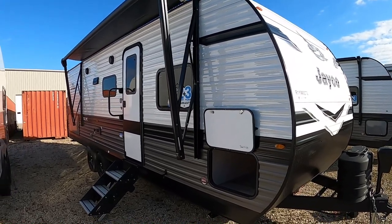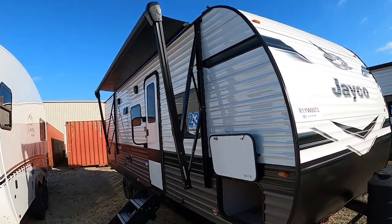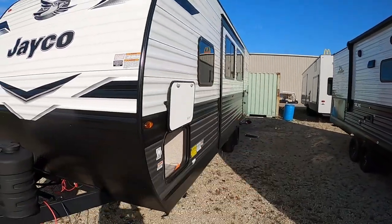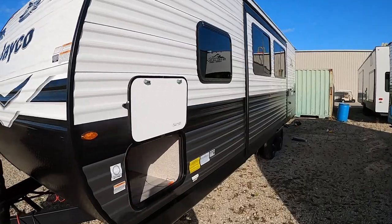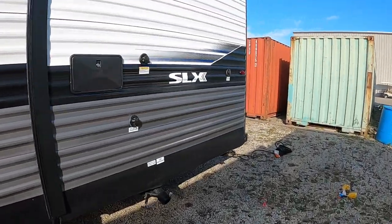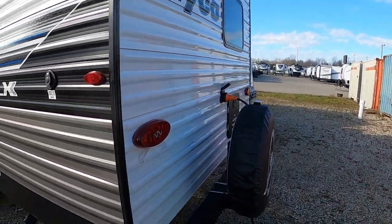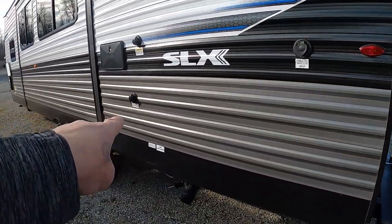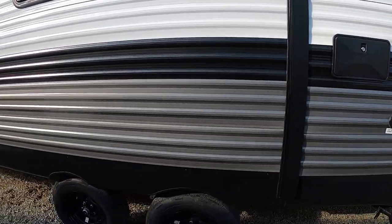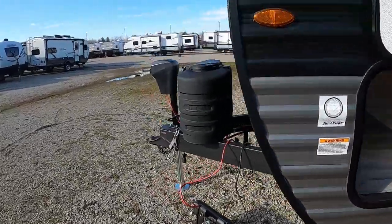Let's start by talking about arriving at the campsite. A few things to take into consideration when you're parking: leave plenty of room on your off-camp side for your slide. Also think about where your power and water connections are going to be. Your power plugs in all the way at the rear, and your docking station for water is around the corner. Park accordingly to utilize the campsite facilities. Once you arrive, unhook your hitch, then level the unit.